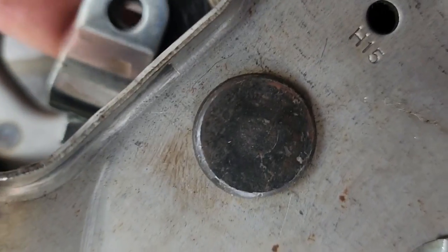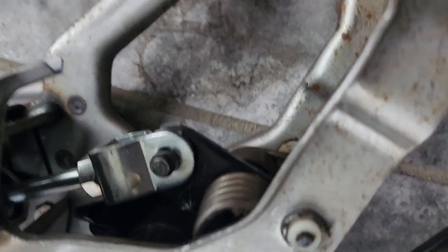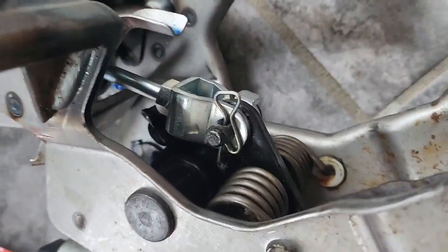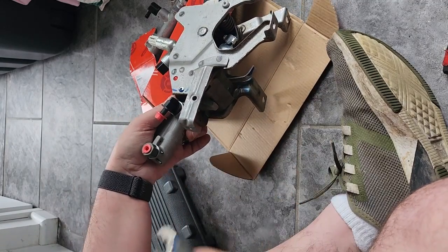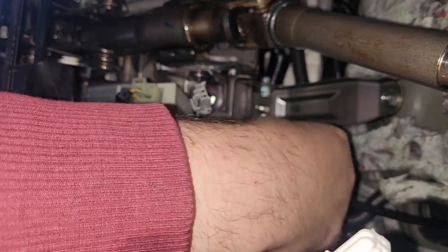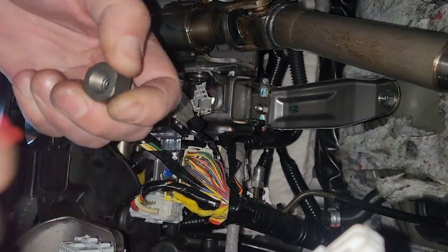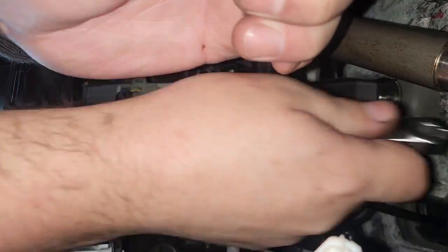This is just a test fit — something you want to get familiar with. I wouldn't recommend fitting it back on and putting it in the same way we took it out; it's going to be a lot easier to do it separately. A lot of that will be blind so you want to get used to putting the pin back in and getting the cylinder into place, because you'll have to do that by feel. On the new part, instead of a little U-shaped pin it had separate pins holding a little adapter in, so I pulled those pins out to put the original U-shaped pin back in. I'll swap the old adapter end over — it's slightly different but nice to use. It's easy to do with a 17mm on the bigger side and a brake pipe spanner on the smaller side.